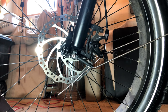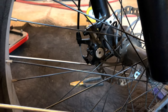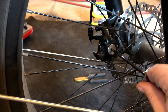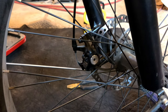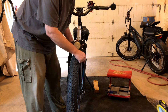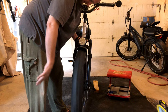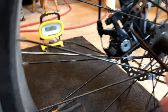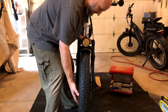Now that the mounting bolts are tight, I'll release the brake. With the mounting bolts tightened and the brake released, I'll come back here and open this up one more quarter turn — there's usually a click. You may need to pull it back out one more depending on if there's any squeak or movement in the wheel. Now I'm going to lift the bike up, spin the tire, and listen for any brake noise. I do hear some, so I'll open this up one more quarter turn, one more click, and re-test the tire.